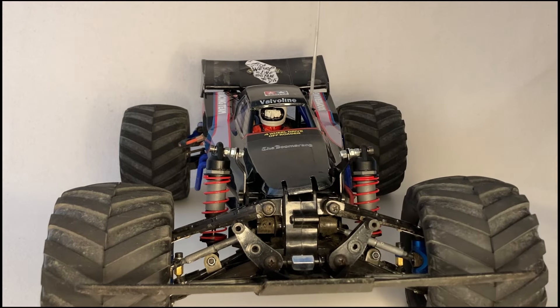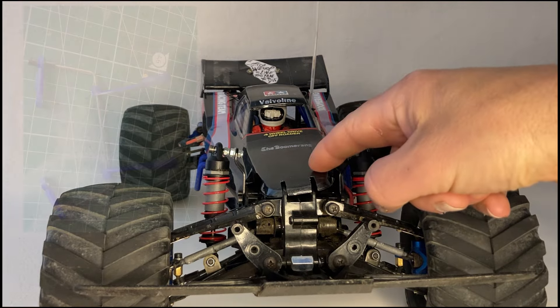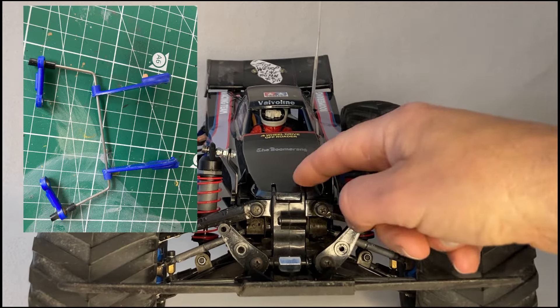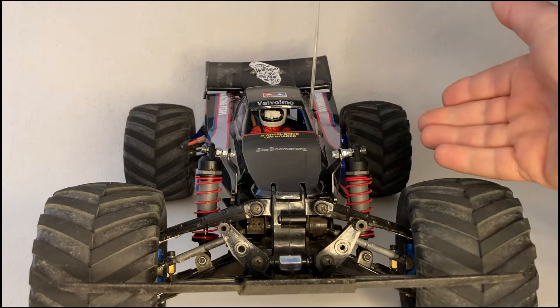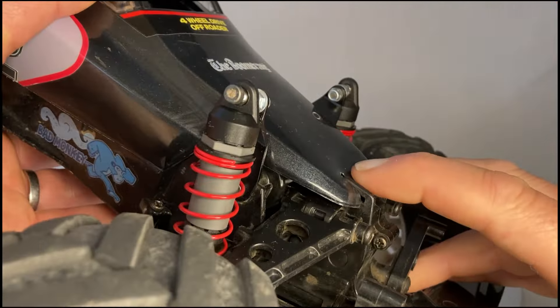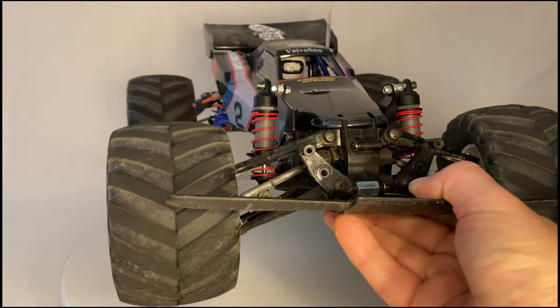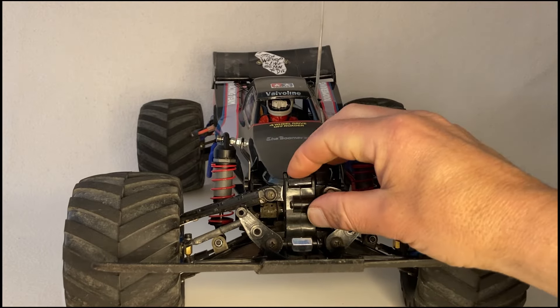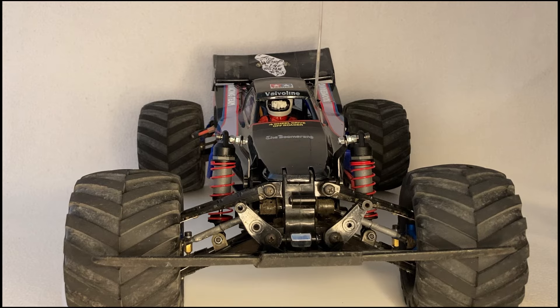Once we've got all these on and everything, there's one more thing that we have to remember. Once you've taken off the old suspension stuff, the stabiliser bar that went over the front here used to hold this bodywork down. And of course, now it's gone — there's nothing to hold that down and the bodywork tends to flap up. Well, you can either run it without bodywork. But what I did is I managed to get a pin just here on the front gearbox — you can see there's a gap there — and I can just wedge a pin through there, so I didn't have to drill any holes or make any brackets or anything. It doesn't look pretty when I put a pin in there, that's why I've not put a pin in there right now for this video. But it does stop the front from flying up.